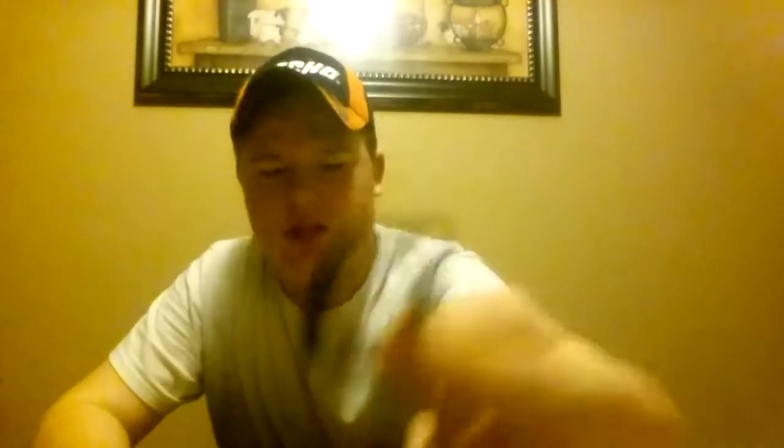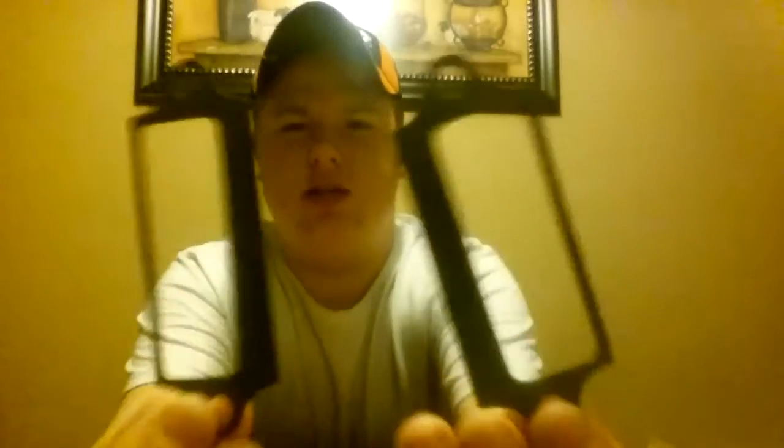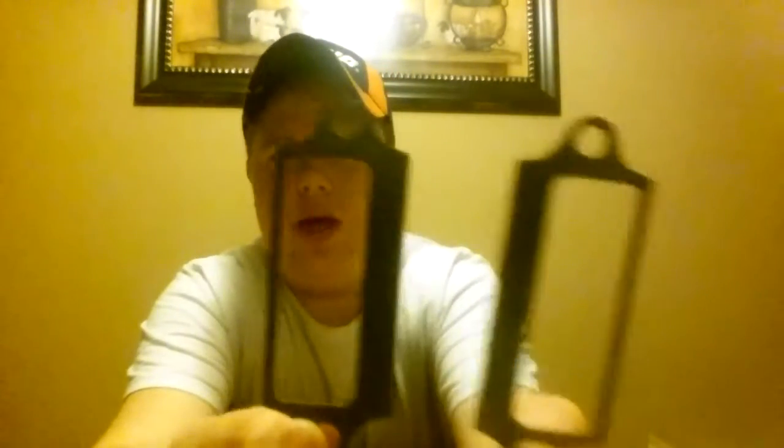There's another one of those thermostat gaskets — so that's two. This O-ring I'm not exactly sure where it goes, but it probably goes on the thermostat housing itself — I'll look into that. These two gaskets here are actually for the reed housing, so you don't have any air leaks where it's sucking in to atomize the fuel.